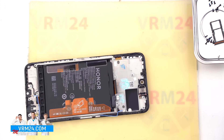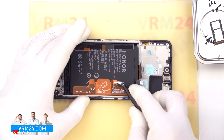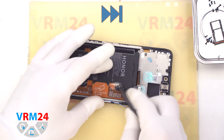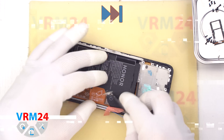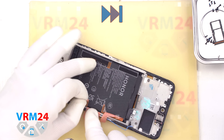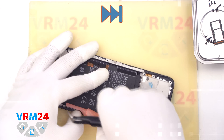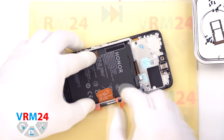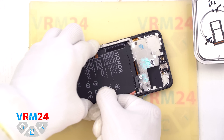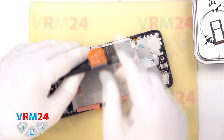Finally, we remove the battery. We fold the brown pull tabs and check the printed instructions on the order in which to pull them. Following the guide, pull the center tab upward to safely detach the battery. Underneath the battery, we will find the transport adhesive layer that protects the display flex cable.